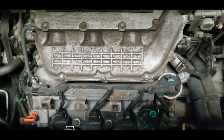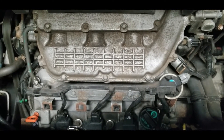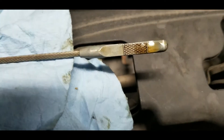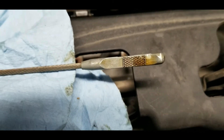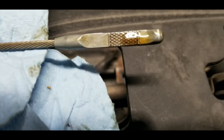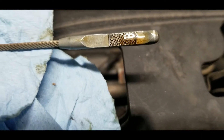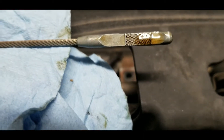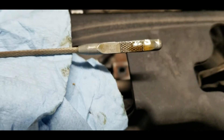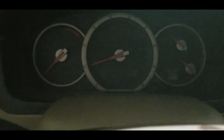After the oil is filled up, run your car for about 30 seconds, then let it sit for about a minute and recheck your oil level. After you verify the level you can reset the oil service life. The oil is directly in the middle of the hash marks — this car does not burn or leak oil. Keep it at or a little above the middle, but never go over the full line as that can cause problems and blow out seals.